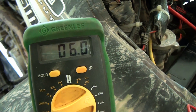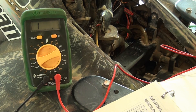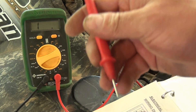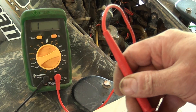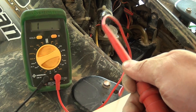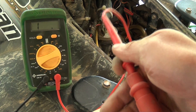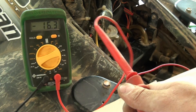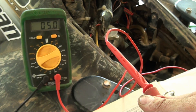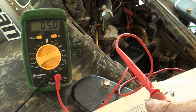Let's test the cap — it should be at 5,000 ohms. You need to make sure you're hitting metal in there. It's dead on: 5,000 ohms on the cap. Remember we have the tester dialed up. So my coil was a hair low at 6,000 ohms.